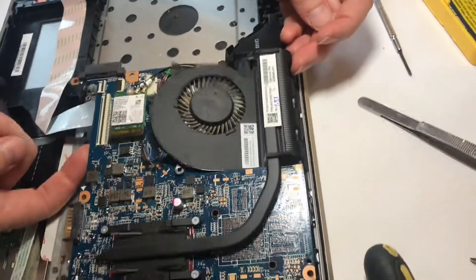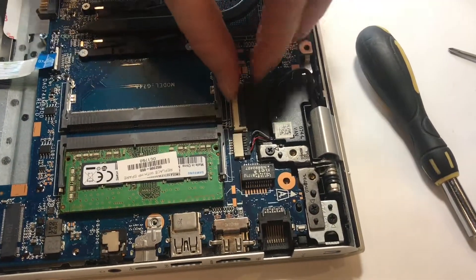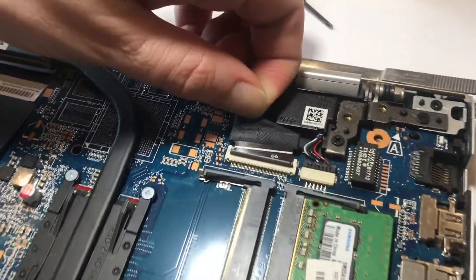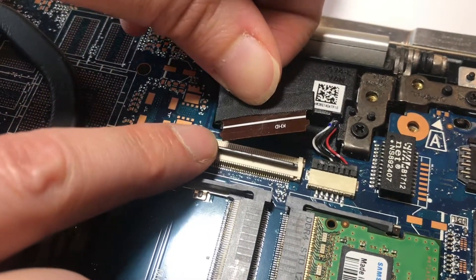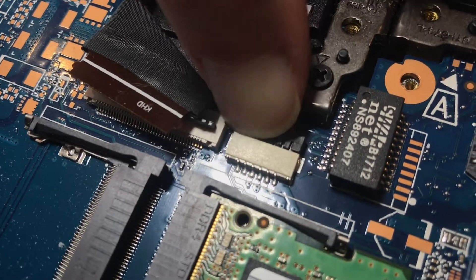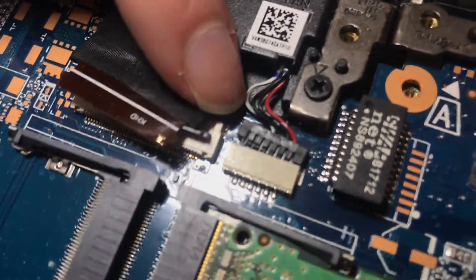This end and this side are free, but this side is not. There are a few more connectors we need to lift — one is there, very, very delicate. This one will also unclip. I'm separating it toward the end using just my finger — don't scratch anything. You can see it's slightly separated now, and I'll do the same over here — see the metal being exposed?